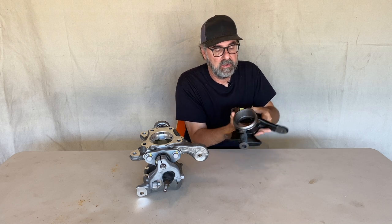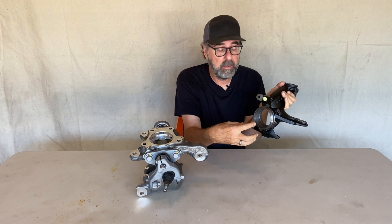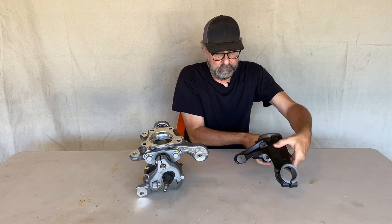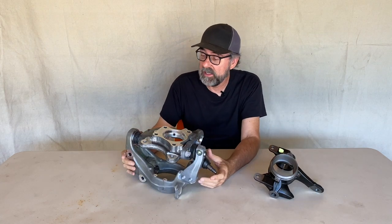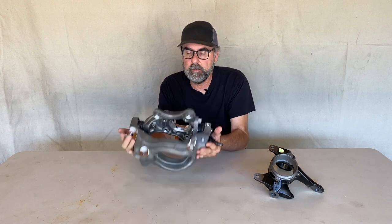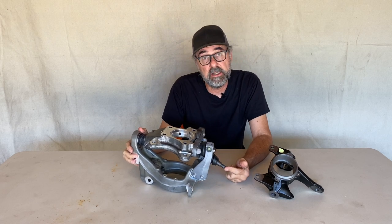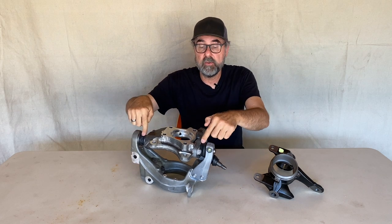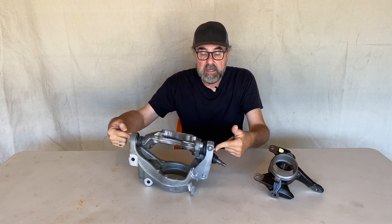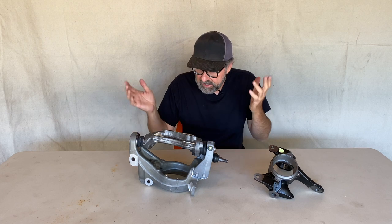This is the standard Civic — the strut drops in here, ball joint attaches here, steering here, and the brakes to these two ears, and then the hub and bearing assembly presses in here. Pretty standard, not very heavy even though it's cast iron because it's not very big. This on the other hand has a lot more going on and a lot more pieces — I've bolted at least four pieces together. The main fork assembly on the back attaches to the strut, and here's the lower ball joint that attaches to the arm we saw before. But there are two more ball joints right here, and these are the ones that make up the dual axis — the steering axis that is independent from the main axis of the strut, which goes between this and the top of the strut bearing. So when they say dual axis, that's what they mean.